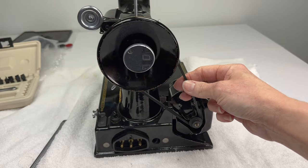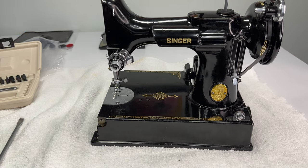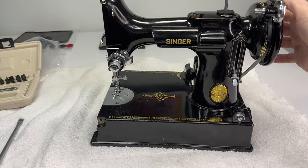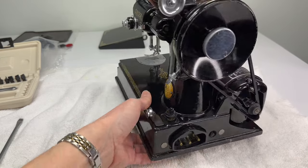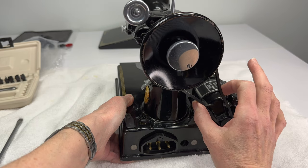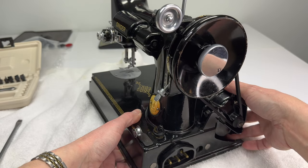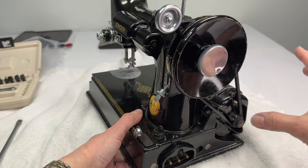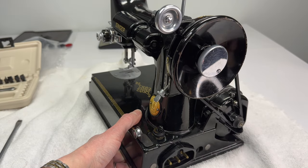These belts are very grippy — it doesn't need to be super tight and stretching out the belt. The stop motion is engaged so my needle bar shouldn't move, and it's not right now. But it was giving me some trouble before, so I don't think I'm done with this hand wheel. So we have the belt back on the machine. Remember when you put it on, you don't want it to be super tight — you want there to be a little bit of relaxation. Normally just loosening your motor mount screw and letting it fall and hang into place is the best way. If when you start sewing you notice slipping, then maybe you need to loosen it or tighten it. Normally just letting gravity do its work will tell you right where it wants to sit. So now we can put those feet back on.